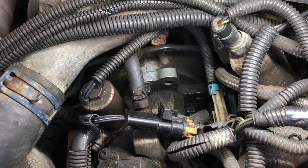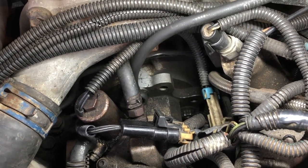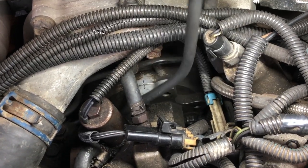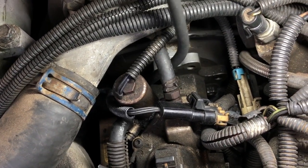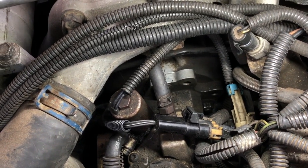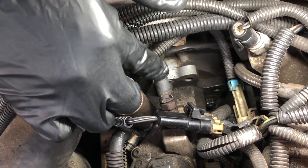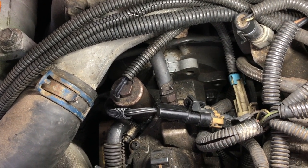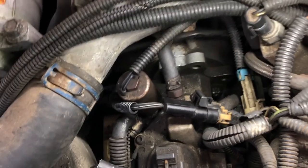With the curved tool I came under this hose to get at the passenger side nut, which gave enough travel — much better than coming in above it. I was constantly careful not to put too much pressure on the rubber hose. It's 21 years old and you're not going to be able to bend it much — it's definitely going to fail if you give it too much abuse.